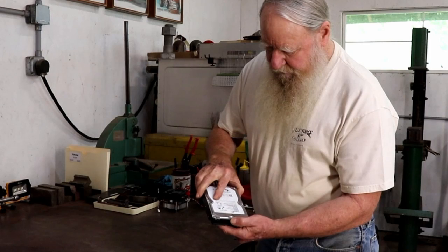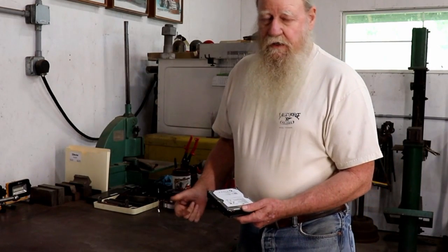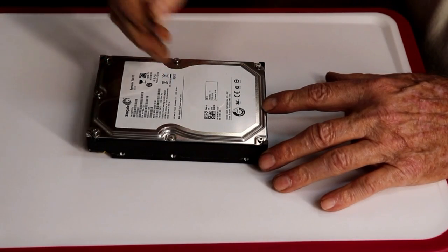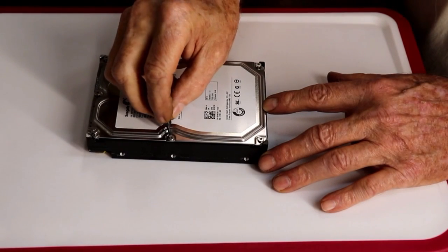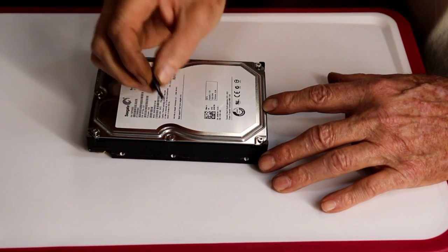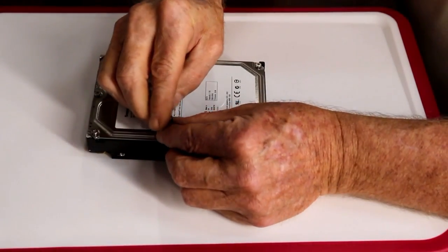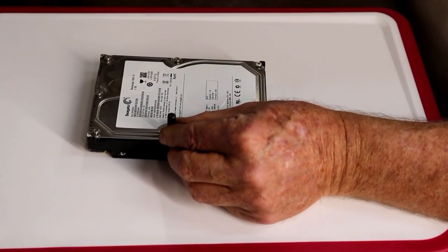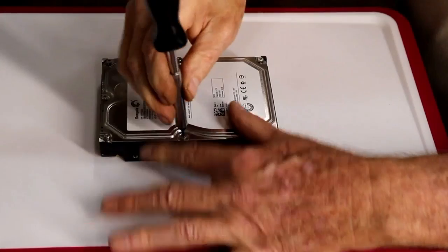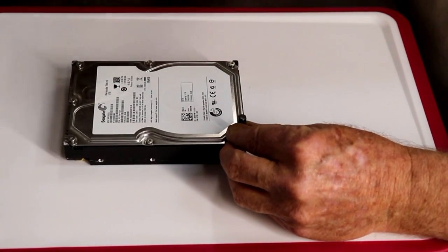Usually there's a couple of screws in here that you have to dig for under this label. Let me get the camera down on the table, get it a little bit closer, and we'll take the cover off of this thing. With the hard drive, I've got it just sitting on a cutting board. The screws are very, very small — almost a star; it's not an Allen, won't fit. This is the only bit that I've ever found that fits these things even close. I have to seat it, get it broke loose, and then work the bit off of it. This is about the worst part of getting these magnets out.